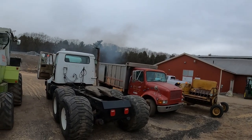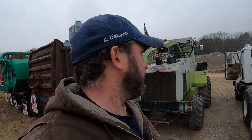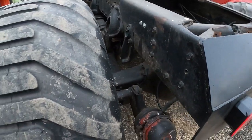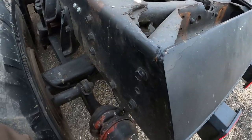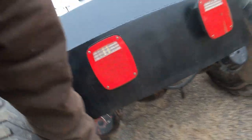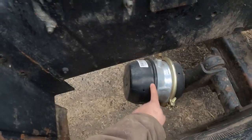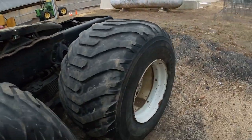This thing's got a 290 Cummins in it — starts really nice when you actually got voltage going to it. In my opinion, good cold weather starter. We'll let it air up. These are original old-school brake cans — the truck's a '78 — and you can still take them apart. I'm not sure what year they stopped making serviceable brake cans. The reason they stopped is there's a spring in there that if you take it apart and it's not properly decompressed, it could explode and kill you.